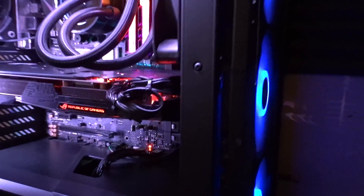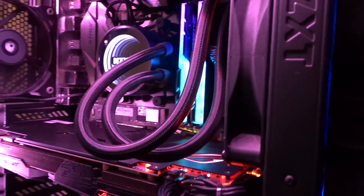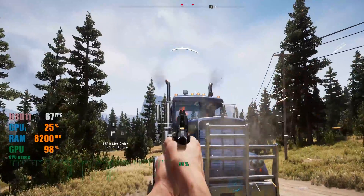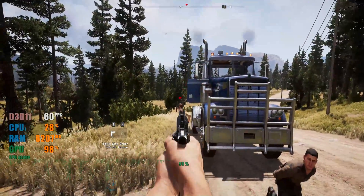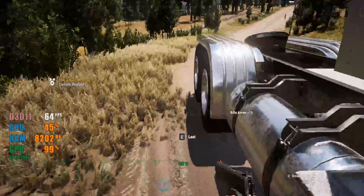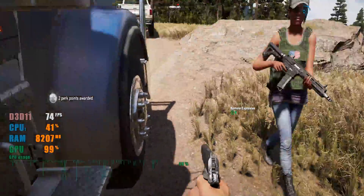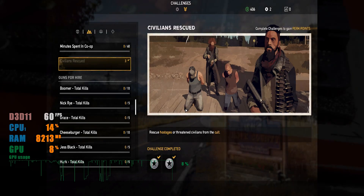This can result in more noise, but that only happens when I'm rendering and not recording at the same time, so it's not a problem. It'll also result in less noise when you're gaming and recording when you're not needing as much thermal performance. One caveat: I've noticed on builds I had to turn up the fan curve a bit because with RGB or LED fans, sometimes the lights won't light up to their full potential unless you reach a certain RPM threshold. I'd say start at about 50 percent and set peak operating temperature to around 80 to 85 degrees Celsius — at 80 degrees C the fans hit 100 percent and knock the temps back down.